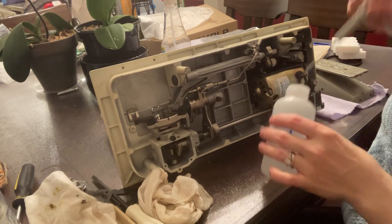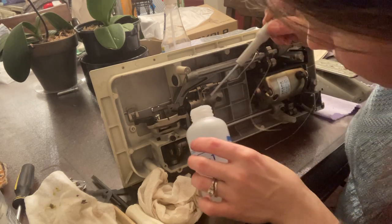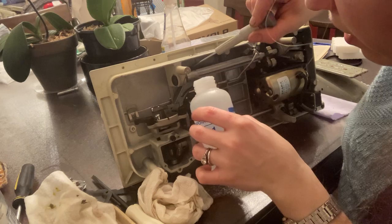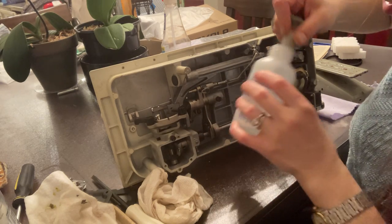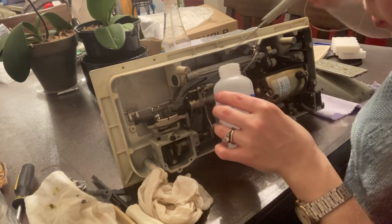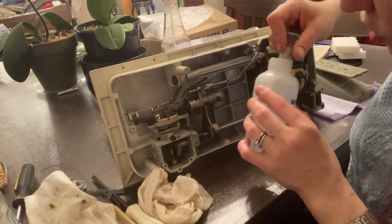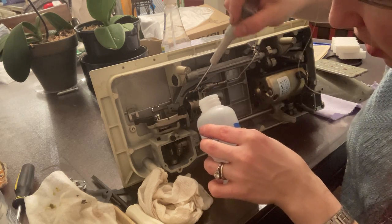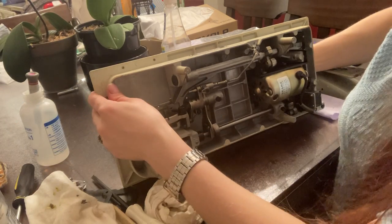Here is our motor — our motor is obviously going to need to be serviced. There's a little bit right there, and also this bar in there — that bar is what moves your teeth. You want to properly oil that too. Just oil everything if it's a metal gear machine — nothing's gonna happen to it. Just don't flood the motor. We're still not moving, so my bet is somewhere in the motor area. We're going to flip it now and remove all this.